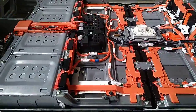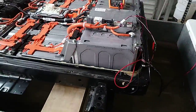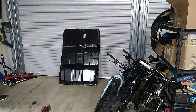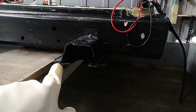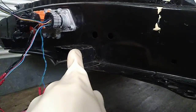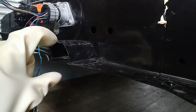So what do we know about this? I knew very little until I'd got my hands on one. What I'd heard is that the battery case is the same size — basically the same floor area. It looks much the same in length and width. But if you notice here, you've got this step up on the support and also here on the front mount. So on the normal Leaf battery, that mounting point is here. Essentially this battery hangs down that much more.